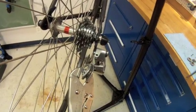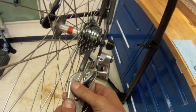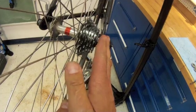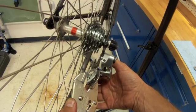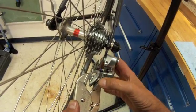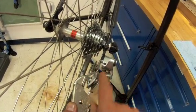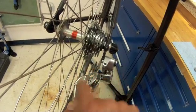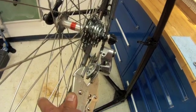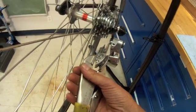And this is why we're doing it this way. With the pulleys in place and we're twisting, it's actually easier to twist these back on the bike. If we took this cage apart, we certainly could. If we rebend this cage separately from this cage, if the inner cage and outer cage are straightened separately, getting these two holes to line back up exactly would be tricky. So that's why we're rebending it in this fashion.